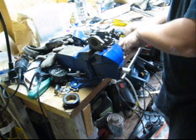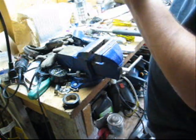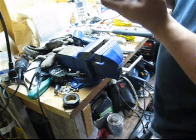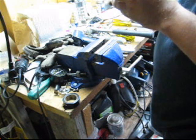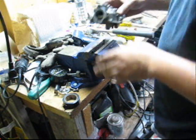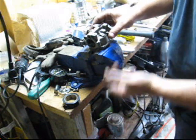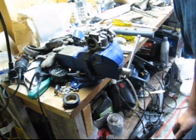And then what that does is it gives you access to your low speed holes. This is the air bleed holes for your high speed. I'll see if there's any lead shots in this kit. I'm not entirely sure. I haven't opened the kit yet. If there's none in there, I'll leave them well enough alone. So I'm going to be right back.